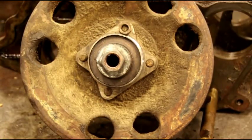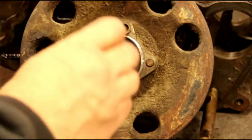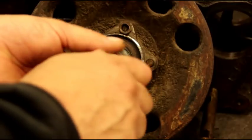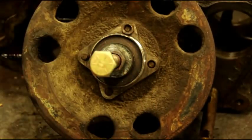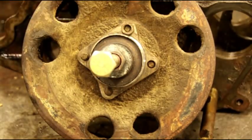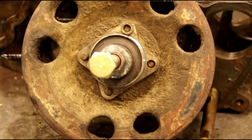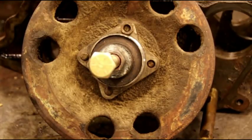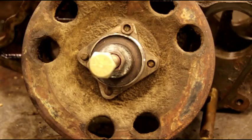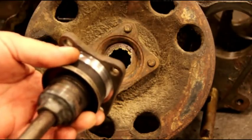It just happened to be a 9/16 because I had that laying around, and I've got a grade 8 screw that I turned the end on. That threads right in there, and as you tighten that screw it's going to press against the shaft and withdraw — it's going to pull your drum right out, neatly and easily. This particular transfer case was very hard; there was no way this was going to move. Some transfer cases the drum will just come off in your hands, but this was one in maybe fifty that absolutely would not budge. That's the puller I made and it works real well — it's strong enough where you're not going to bend it.